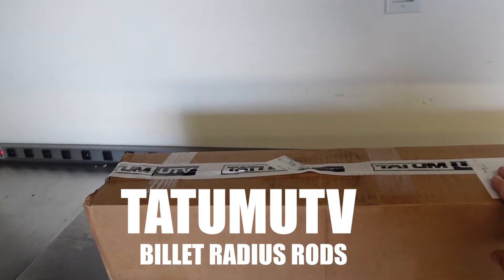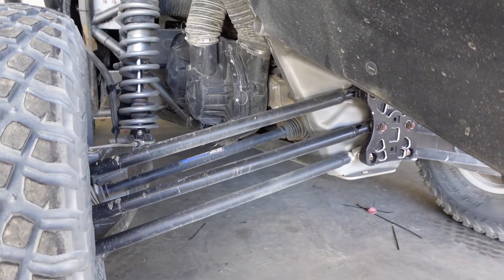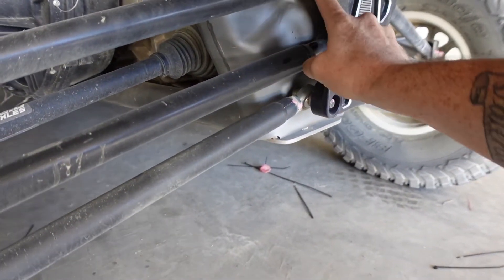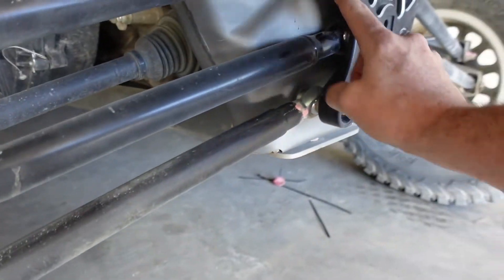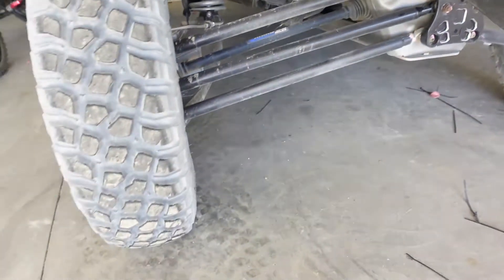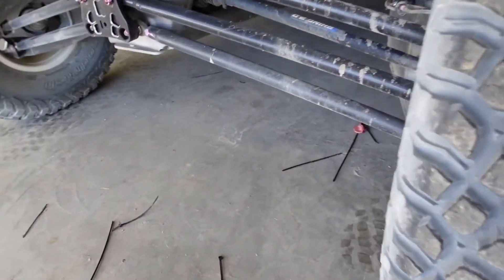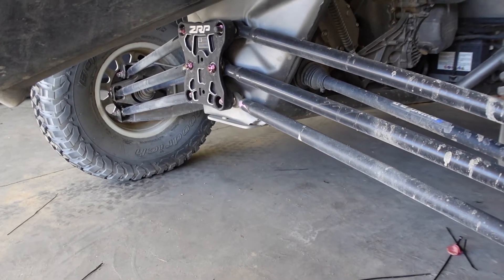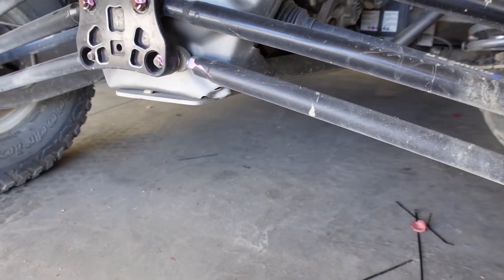These are billet. So you can see these are not stock, but these are also not ideal. These radius rods here do not have any adjustability other than the bottom one. And so we want to be able to adjust these two. This will allow us to adjust the toe-in and get a better alignment for better handling. This is from Nico Festino, Fest Motorsports — he's helping me get this thing dialed in. These are solid chromoly, they work great, no problems, other than we're missing adjustability.